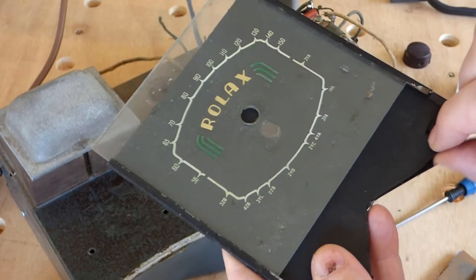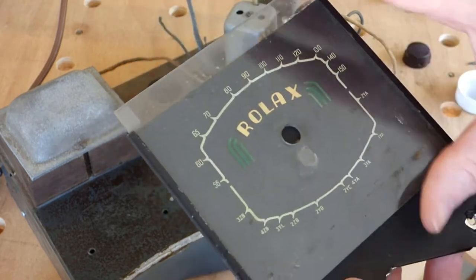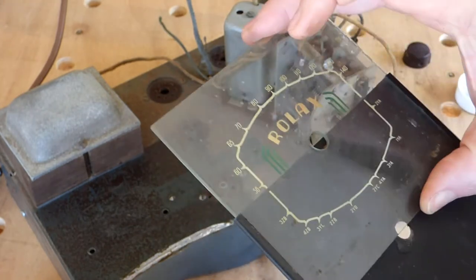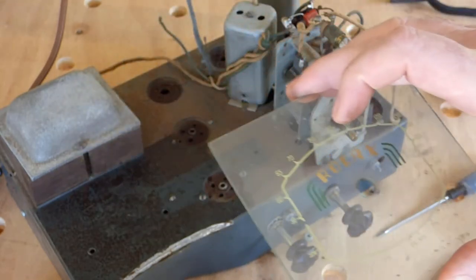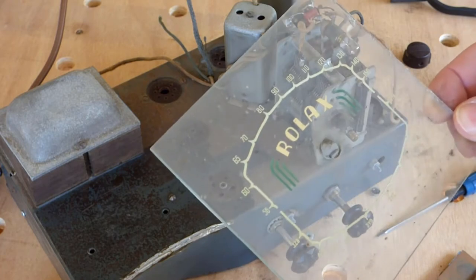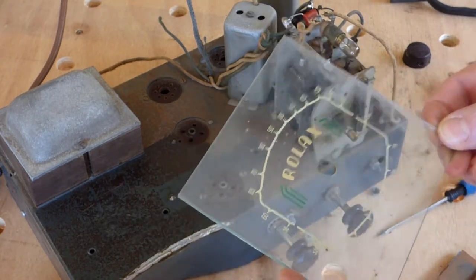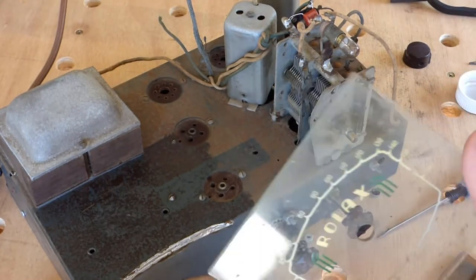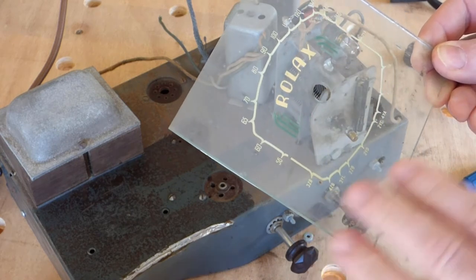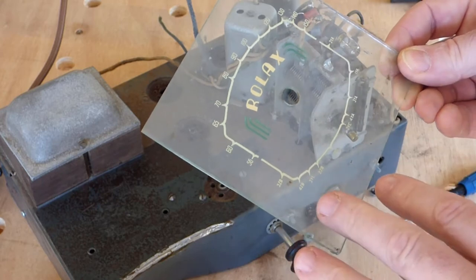The backing paper is just black paper. I think I've got some black paper I can replace it with if needed, but it should be OK. Really all I want to do is clean the glass — being careful not to clean the ink off the glass, that would be bad. Also careful not to drop it. Ask me about that time I tripped over the power cord of a radio I was working on and smashed the glass, then got a replacement glass and smashed that too. Actually, don't ask me — I don't want to talk about it. I'm going to clean it with some isopropyl alcohol on a rag. Sometimes isopropyl alcohol will do less damage than water will, strangely enough.